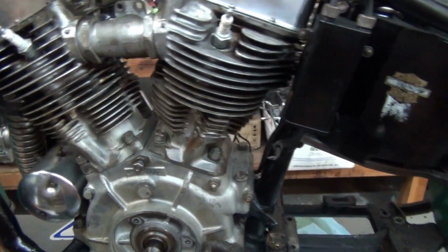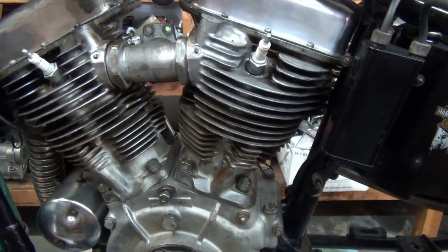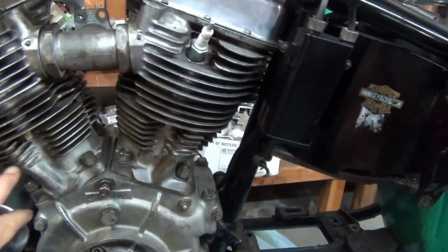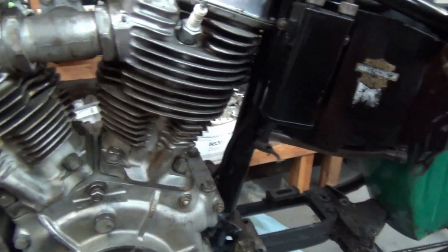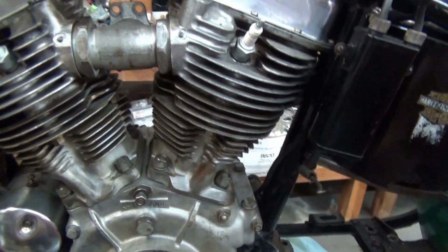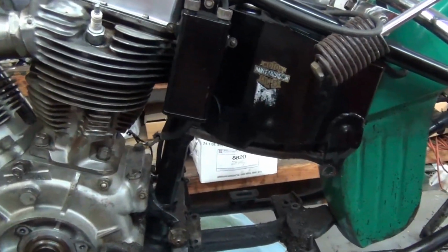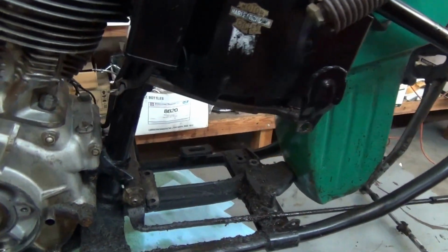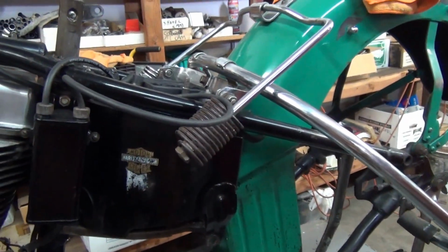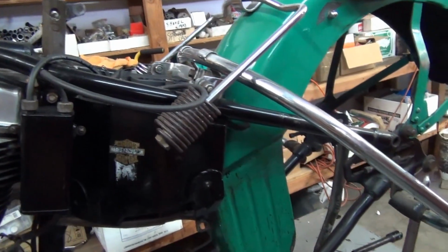So, as you saw from the green bug, we did have to repaint these cylinders because there was no paint left on them once we got the oil off. I suspect the same thing is going to be true for this. This is not special heat paint, and it just comes off. So once we clean the oil off the cylinders, there's not going to be any paint. So we'll repaint them, I'm sure, and it'll repatina the second we heat it up because we'll put the same paint back on. It just goes right back, and you can't even tell. So we'll get rid of all this nastiness, put it all back. It'll be all nice and clean, and wow, when we get done.